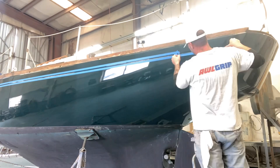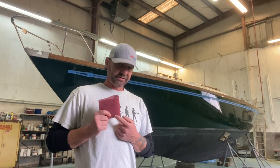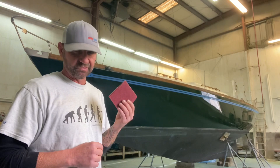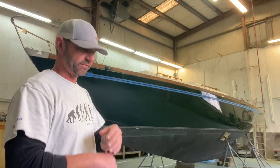All right everybody, this is going along pretty good. Now I'm going to go ahead and sand, but I'm just going to be using a scotch brite. The paint is still extremely fresh and this is all that's required to get the paint to stick. One of the advantages to using a scotch brite over sandpaper is I can hit my tape edges and I don't have to worry about damaging it or creating openings for bleed through. I'll jump in with y'all when it's time to mask.